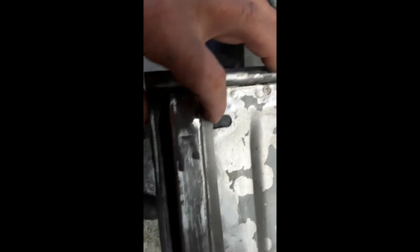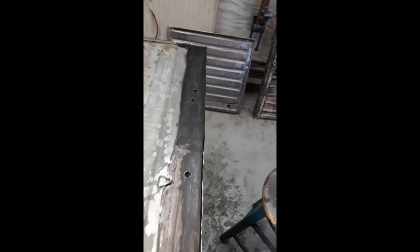Here's the repair piece, come together okay. I've got some phosphoric acid on that now. It's not quite sharp enough in there, but all in all quite pleased since I'm making it up as I go along. A bit of spray-through primer — a weld-through primer.